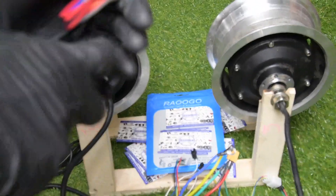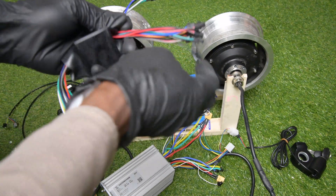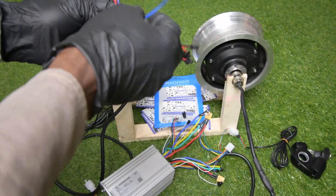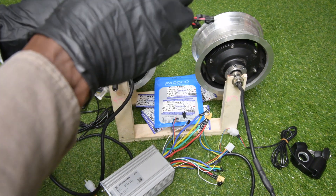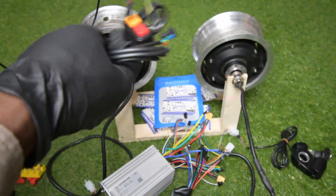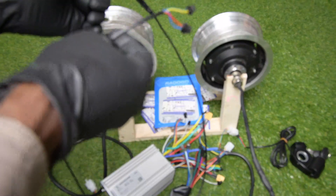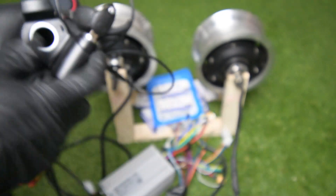So now you know all the wires. The connectors I will use to run these two motors are: the throttle connector, the power ignition key connector, the single/dual drive connector, and the eco-turbo connector. I will just use those wires to run my two motors. This is my eco-turbo single/dual drive button connector. My throttle is right here — the throttle works with this display, the TF100 with five pins. I already connected the connector here, and I also have my power ignition key right here.